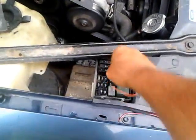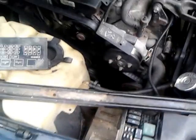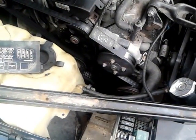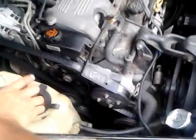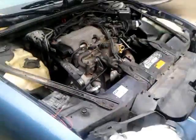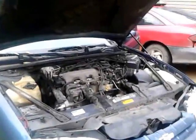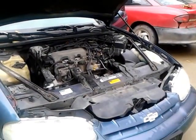Pull the wire out for a kill switch. I hope this video may help somebody. If your VATS system — which is what this security system is called — you can research it and find out what resistance your vehicle needs. You can call the dealer and they will tell you the resistance.